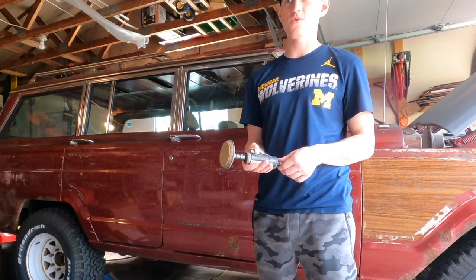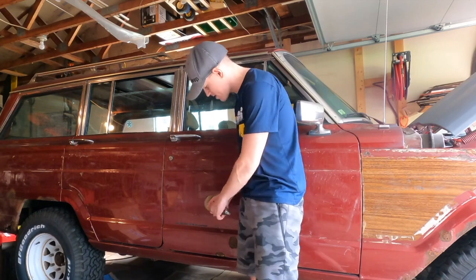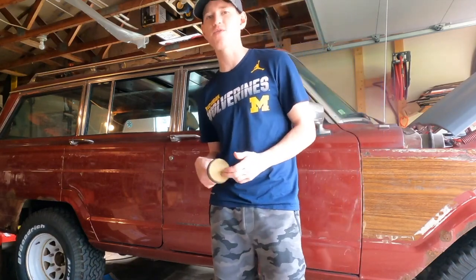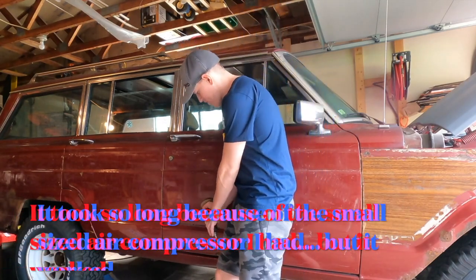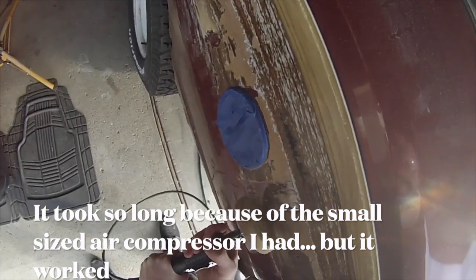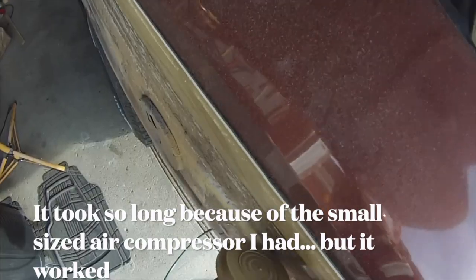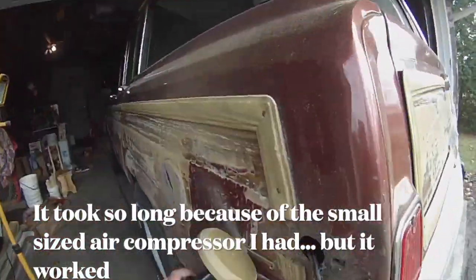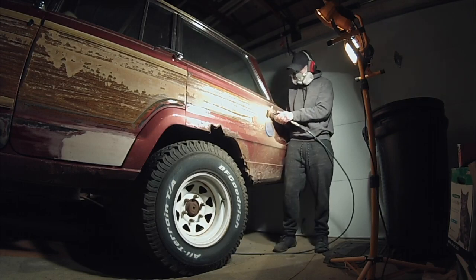The eraser wheel is used for taking stickers and vinyl off of a vehicle without scratching or damaging the paint, so you can really use it on any sort of vehicle. It does leave a little bit of residue behind, but if you keep going at it, eventually the residue will come off — or you can use a residue remover like Goof Off. It took me probably about a week straight to go around the whole vehicle. I got most of it off back in the winter of 2020, then stopped, and eventually took off the rest — excluding the fenders — back in June or July of this year.